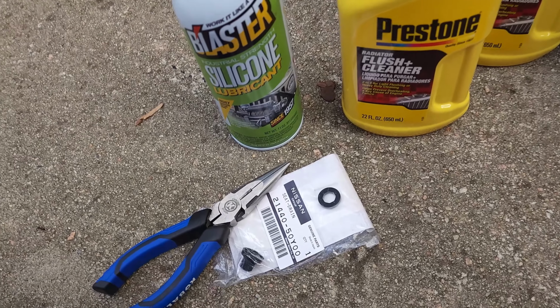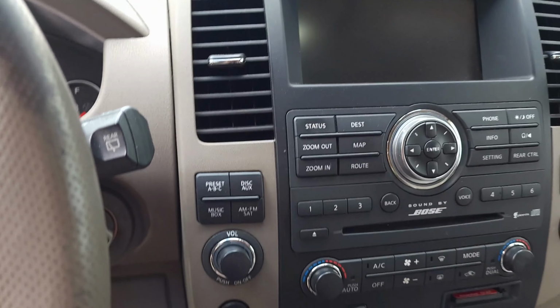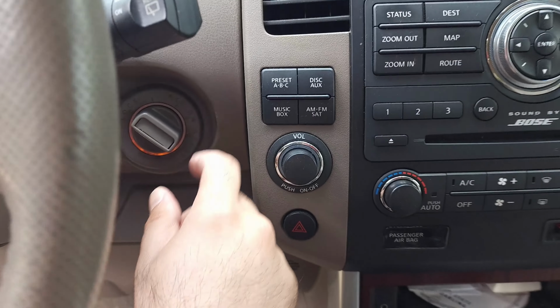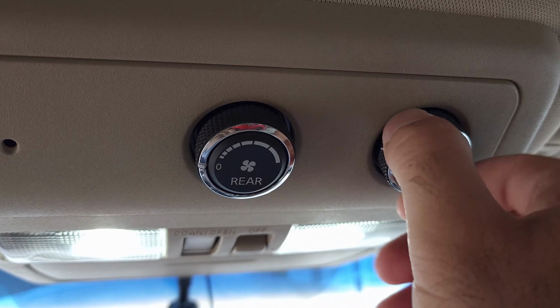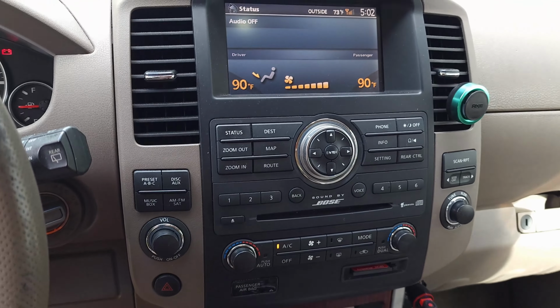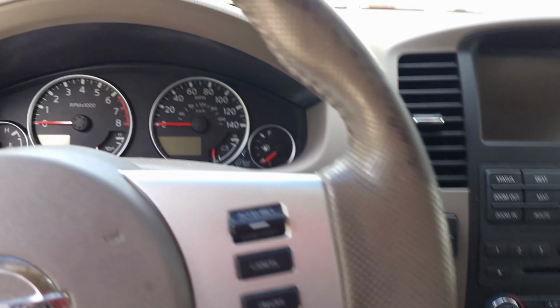This is from Nissan. So one thing also I forgot to do last time is turn the heater on for the back heater, so I'm going to do that now. The heater should still be on. I also this time didn't open the radiator cap. I left it closed because last time it spilled out, so I'm gonna leave it sealed. Okay, so I'm gonna put it in the on position, just on, and then the back heater all the way maximum to heat and fan maximum. We'll leave it 10 seconds. Power supply, that is it. That is 10 seconds.